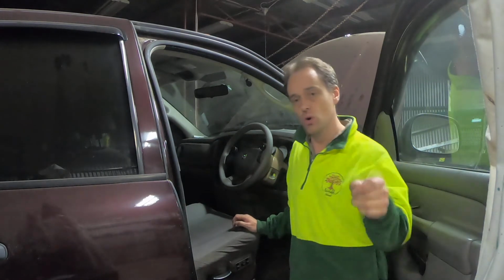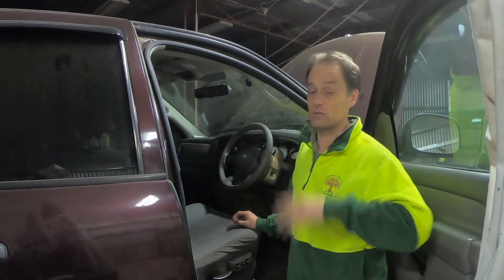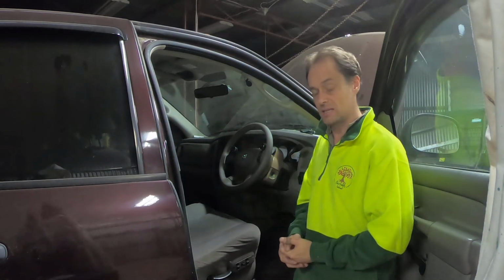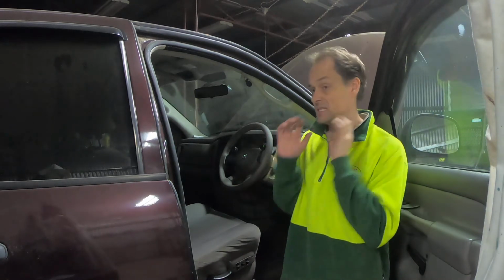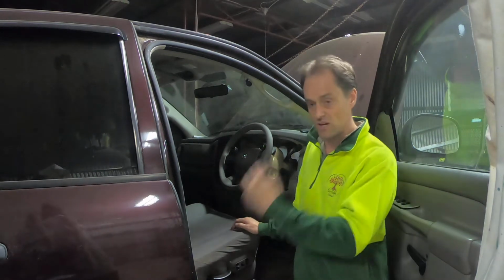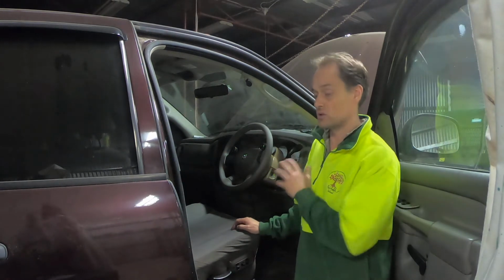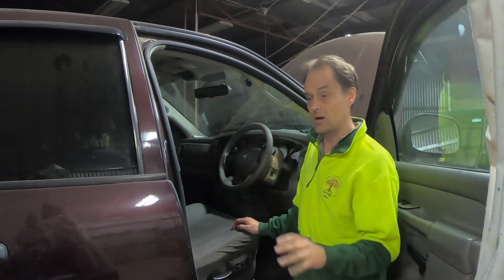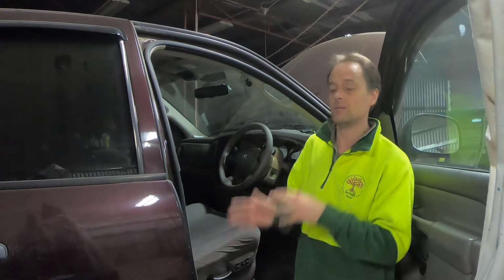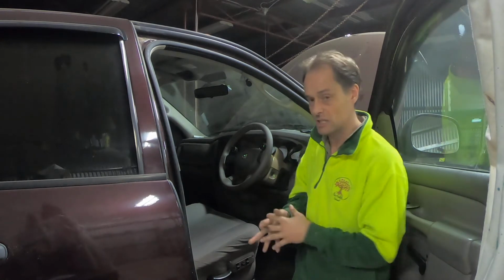But you'll know driving one of these things along if you're worried about transmission temperatures and EGTs. That would generally come when you're towing a heavy load or you're going up a prolonged incline at speed and the car's really working. You'll know when you particularly need to take notice of the EGTs and the pyrometer. If you're fitting one of those gauges to your car, and you're going to do some heavy towing, it'd be good practice to do some normal driving around without a load and get an understanding of where your temperatures are going to sit normally. When you put a load on, you'll know how far outside of normal they're sitting, and you'll be able to judge if that's a concern or not.